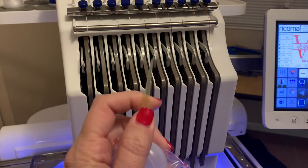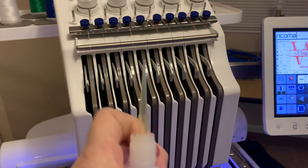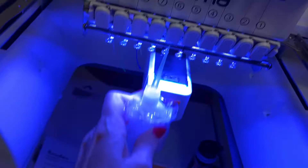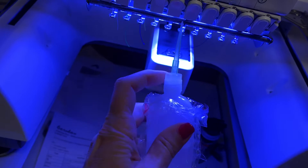They'll send you a bottle of oil — regular sewing machine oil. There's a pointy tip in your toolbox; be sure to attach it to the bottle because that enables you to get the oil exactly where you need it. If you just use the fat tip it's not going to reach where it needs to go.